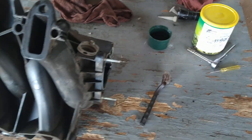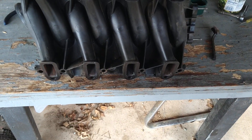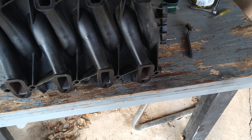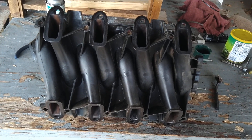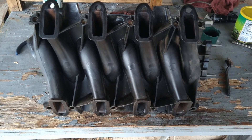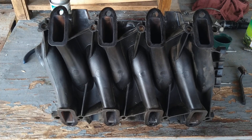I sprayed the degreaser in there, brushed it out again, and I'm going to do that again, then dab it out with a rag down in the hole. I'm going to take it to the water hose and just blast it out good, then use compressed air to blow it out as good as possible and leave it sit until next weekend. Thanks for watching — I appreciate your comments and support. Have a blessed day.